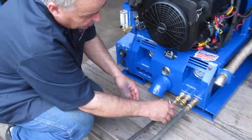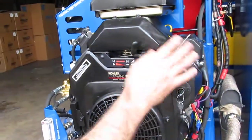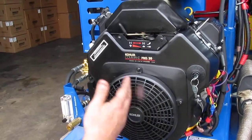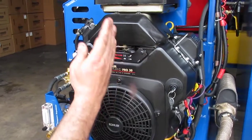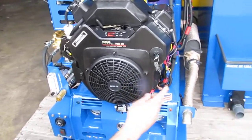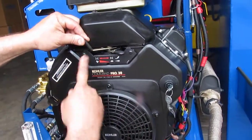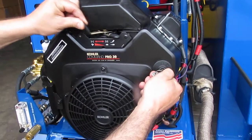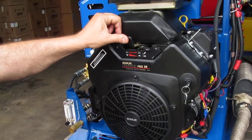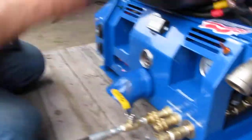Move the throttle and the choke handle all the way to the right, just like the Infernos. Move the throttle a little bit to the left, move the choke all the way to the left as you crank — open the choke. If the engine is extremely cold, do not open the choke all the way; bring it to the center and allow the engine to start running rich. You'll be able to see rich fumes coming out of the exhaust. The engine indicates it's ready to run when you can open the choke completely. Go ahead and hold the choke, turn the engine on, then bring the choke to the center — and you'll see the rich exhaust coming out. Now go ahead and open it up.